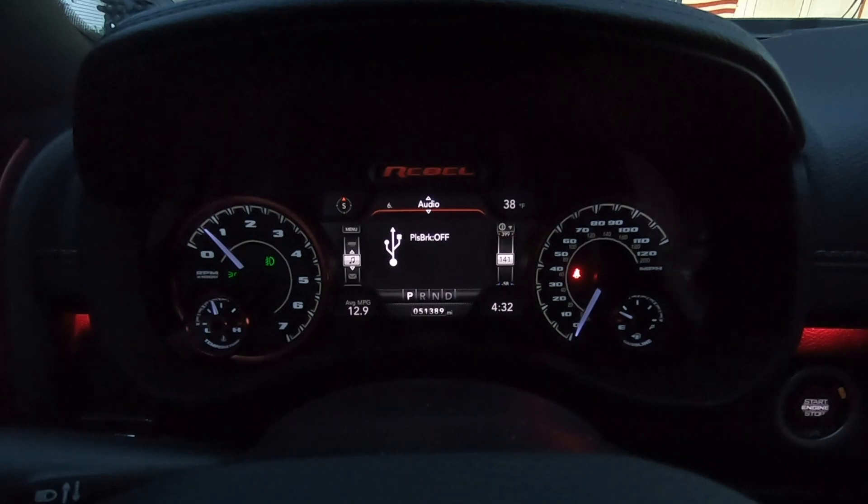This is the speed at which it blinks when it does blink. Off means it's completely off — when you hit the brake it's just a steady on. Fast means it'll blink really fast, then medium, then slow. We'll put it on medium. Medium speed is good, then we're going to hit cancel again and go into pulse brake numbers.